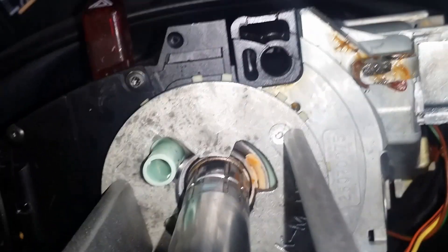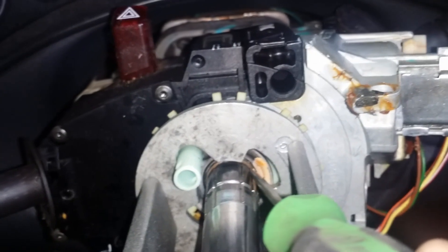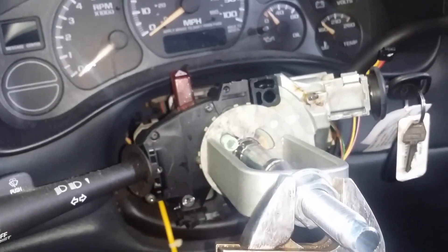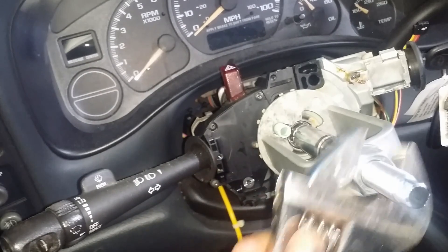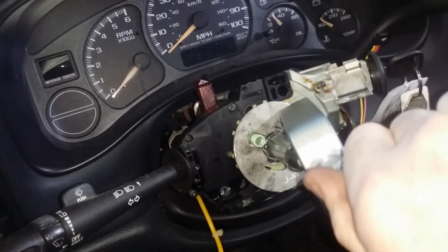The plate is compressed — you can see there's a little gap in there now and you can get that retaining ring out. The best approach is to get a pick down in there and get behind the ring, pull it out of the groove, then get in behind it with a straight screwdriver and pry it off the shaft. Once the ring is out of the groove, slide it all the way up and let it stay on the tool. Then loosen your nut to slowly release the tension on the plate and take off the tool.